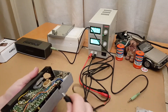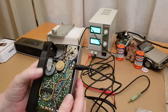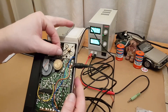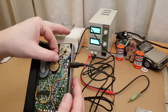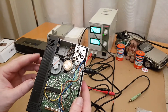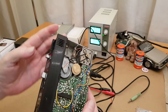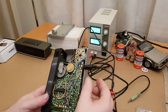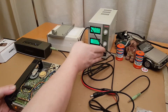Now I've taken it off you can see how loose that is. Let's get that plugged in and try again — now you can see it's spinning. You can see how floppy that belt is. The stop button, by the way, doesn't stop rewind and fast forward — only stops play.